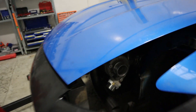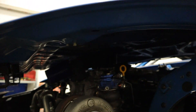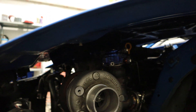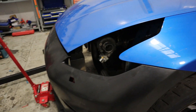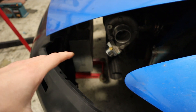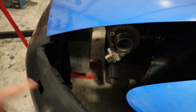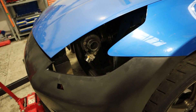We've put the bonnet and bumper and stuff on and got things roughly in place. We're just kind of propping things up at the moment and we're looking pretty good. Clearance-wise it's very close to the bonnet, but there's a bit more of the bonnet skin on the inside that we're going to take out anyway, so that should be fine. We've just been putting the intercooler in to offer up where exhaust stuff's going to go, where the bar's going to go that's going to mount the intercooler - all that jazz. Next job is to start actually making the chassis legs.